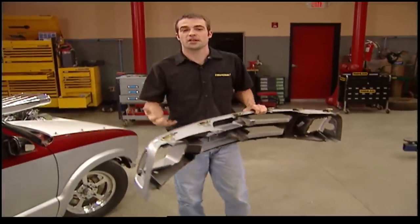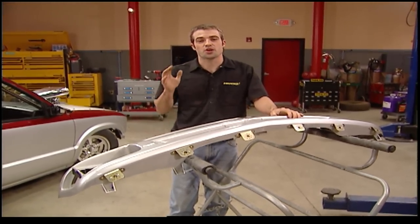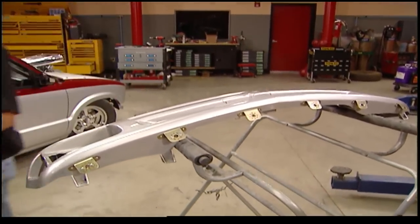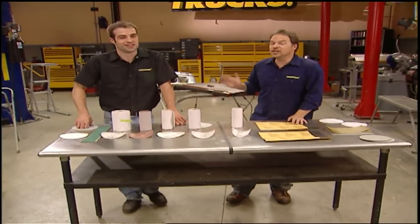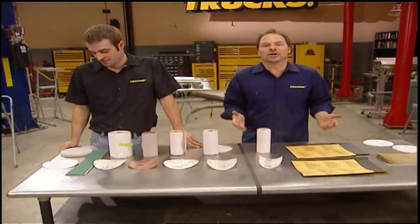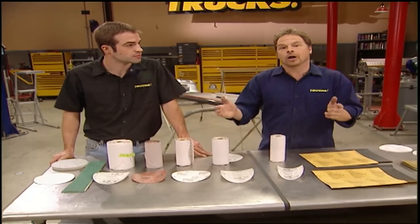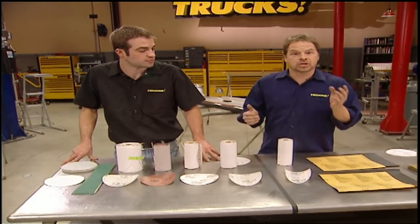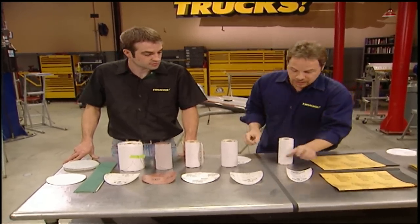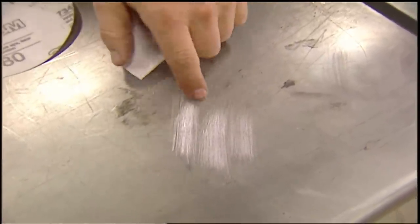If you're just joining us, we're doing a little experiment to show you guys that with the right equipment and a little investment in preparation, you can get great results with your very first paint job. We've already talked about guns, compressors, and safety gear — now it's time for a little work. Ryan has never painted before, so if he can do it, you can do it. There are only two ways to make paint stick to a car: chemical adhesion and mechanical adhesion. Chemical adhesion is when two wet layers bond together as they dry or cure. Mechanical adhesion quite literally puts a deep scratch into the surface and gives the paint something to hang on to.